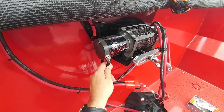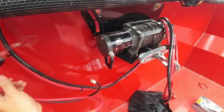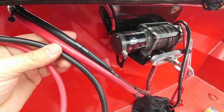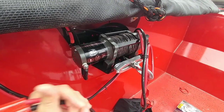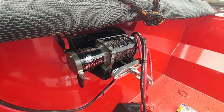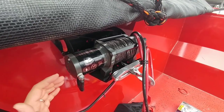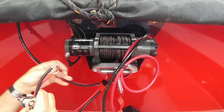The first thing I need to do is disconnect the two 10-millimeter nuts from the wires, disconnect the two-gauge wire, and install the 20-inch section of six-gauge wire. To show you the difference in size - the two-gauge is about a half inch in diameter overall per strand, while the six-gauge is probably a little more than a quarter of an inch. Six-gauge cable is more than adequate for the power output requirements of this winch, so I'm not taking a risk of overheating anything. Anytime I use this winch I'll be using it with a snatch block, maybe even two snatch blocks, to double or triple the capacity and put less strain on the motor.